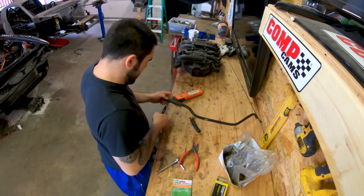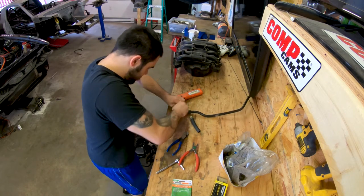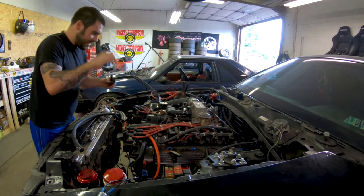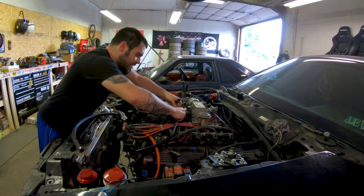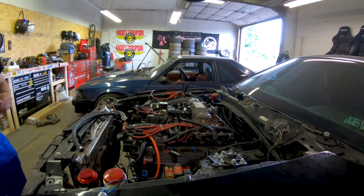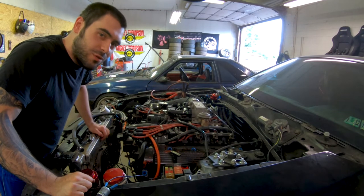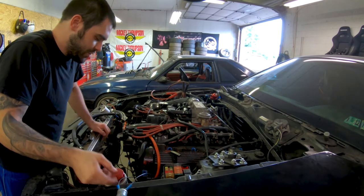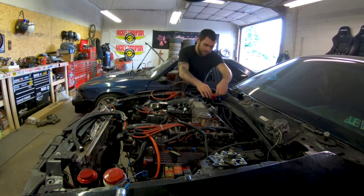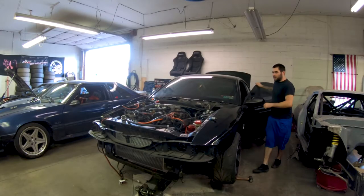The garage is an absolute mess. I was going to film the other day but I had such a bad time trying to make this work - it was just absolutely terrible. The fuel pump is back in the CCRM module, it's kind of not really the correct way it should be on the circuit but it's close enough. I should have it further back in the car where it comes out of the keyless entry module. I still have the starter on a switch and the fans on a switch. I don't know what my fuel pressure is set to though - I'll start the car and see if there's any difference. I have mufflers on it this time so it's not super loud.